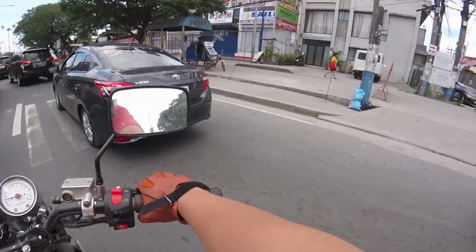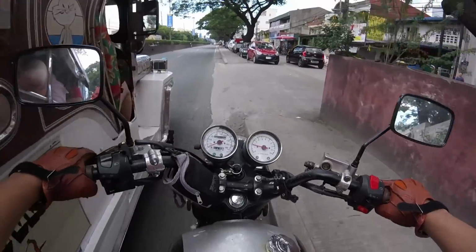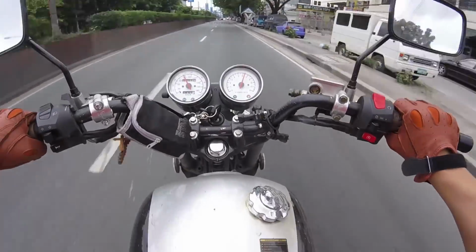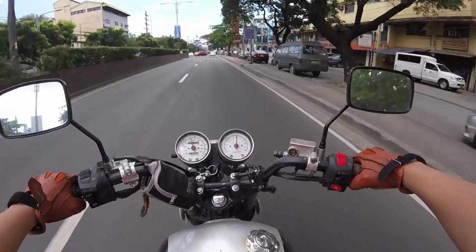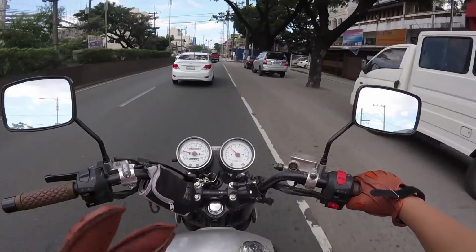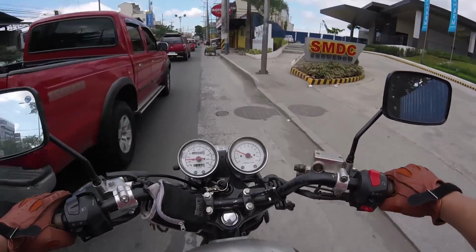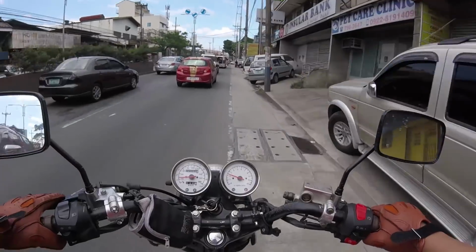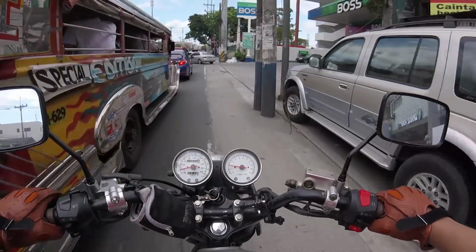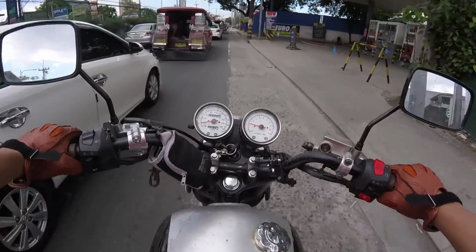Okay, so as I was saying, I still have this issue about the clutch pull, clutch adjustment. If you notice, I'm having that issue on my third gear pull, which is common if you have a loose clutch adjustment that isn't right. You tend to slide the clutch over when pulling really hard. That happens to me on third gear, but on first and second gear, it's all fine. I can feel the pull is just fine. But then again, of course, it's an issue, right?